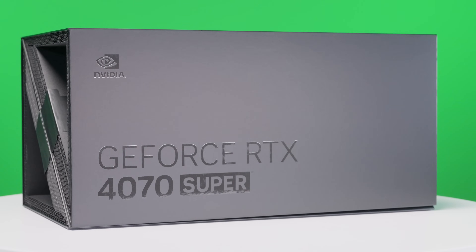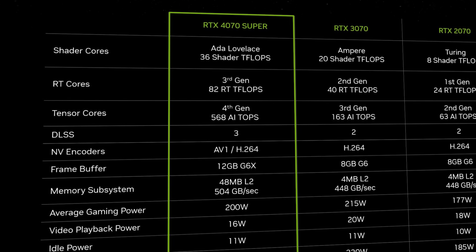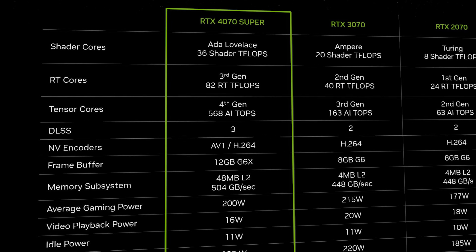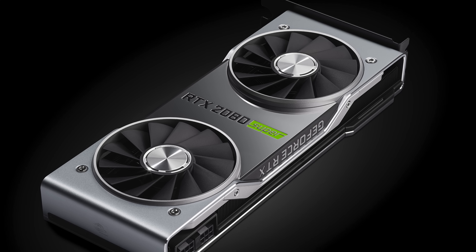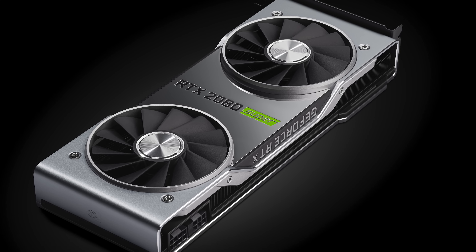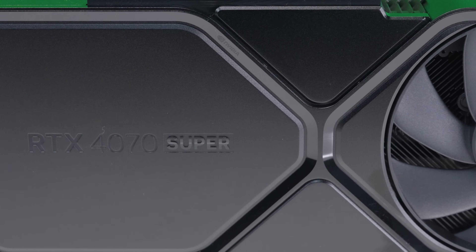Before we get too far, let me introduce you to this guy right here. This is the new RTX 4070 Super, the whole reason we're now making this new video. This GPU has 12 gigabytes of GDDR6X VRAM running at a memory interface of 192 bits, a base clock of 1.98 gigahertz, and a boost clock of 2.48 gigahertz. It's brand spanking new, and I love that NVIDIA ditched that whole green tech super line and went with this rad, black, smoked-out design.